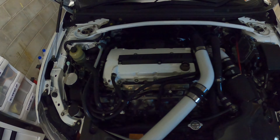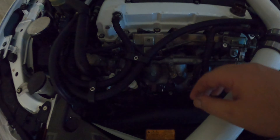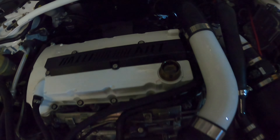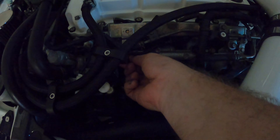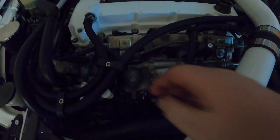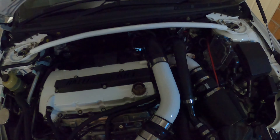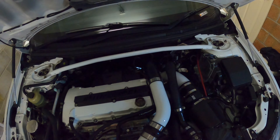Okay, so here is the finished product. It's actually been a couple of hours just because we had to run out and get some plugs. I had to get a plug for this one down here and for the back into the intake there. I've got a 10mm vacuum plug here and got it over and zip tied it - it should hold. And one at the back is an 8mm. Probably swap that out for a 7mm or something smaller as it's a bit big, but we've got it zip tied on.